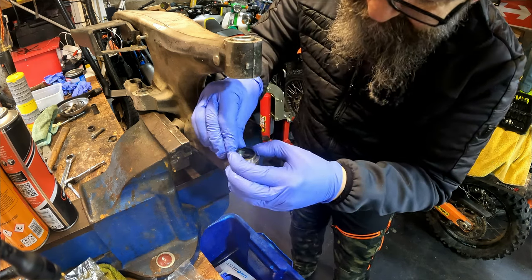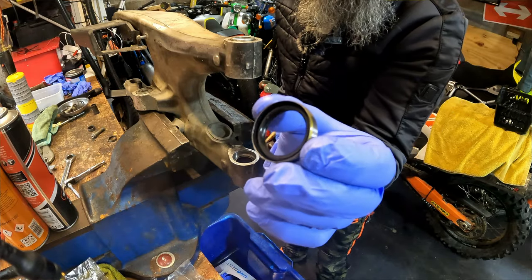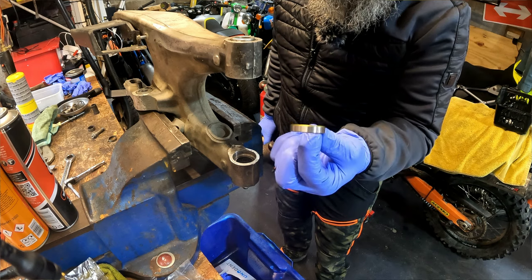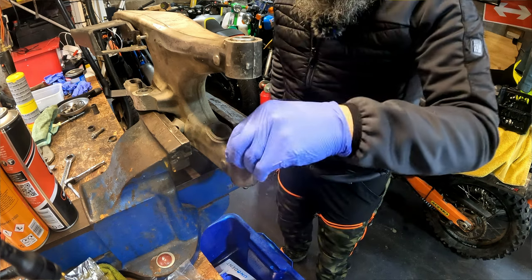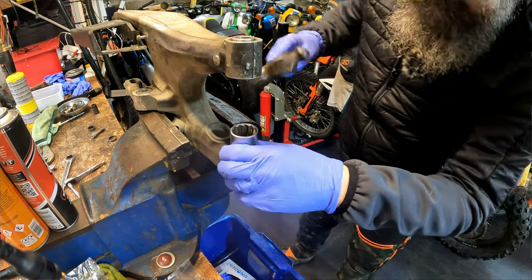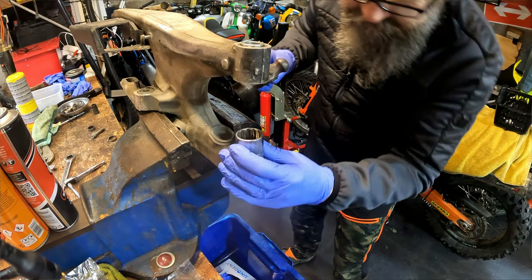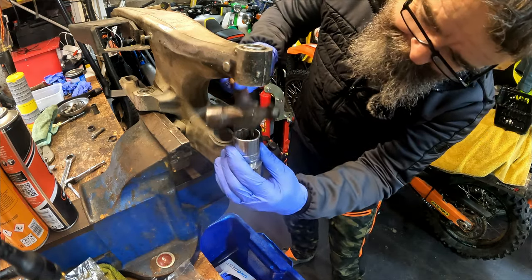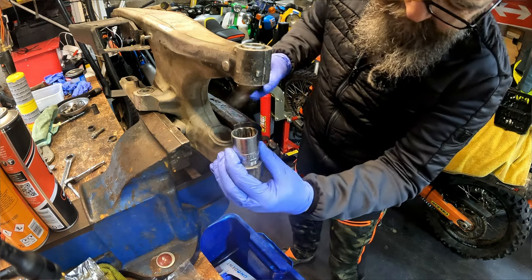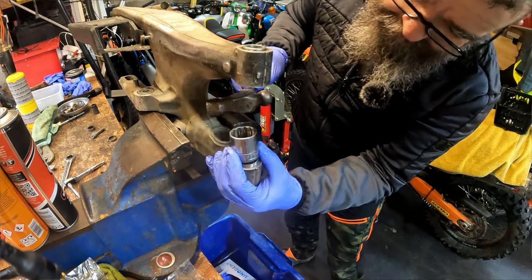They can be a complete pain in the butt. They're like a spring seal, and where you can see the different colour on them, it does have a chamfer on it. But sometimes this gets a little bit worn, and trying to insert it, because that's like 3 thou bigger than that, can be a bit of a pain. You try and get them in square, one side goes in and one side doesn't, and you need to get it in fully square. It's like a spring seal.